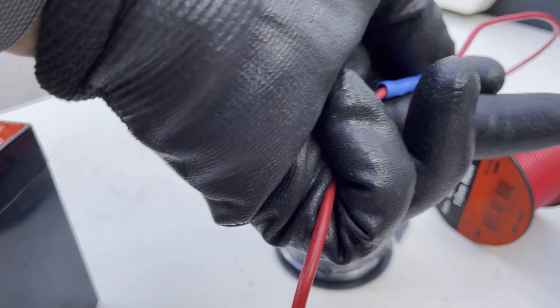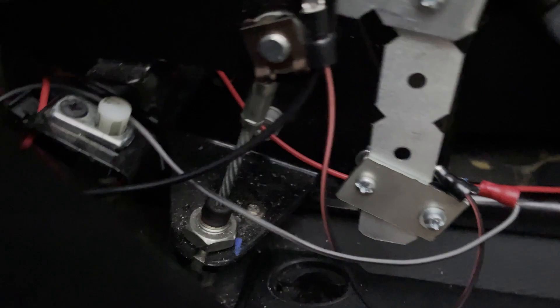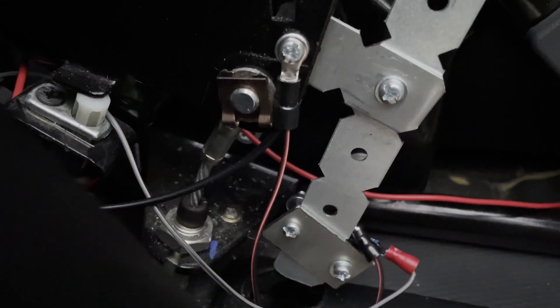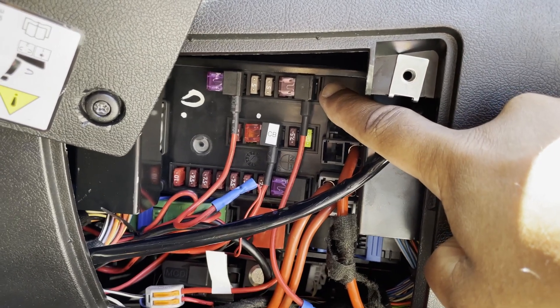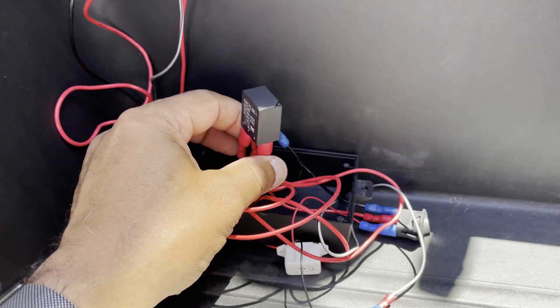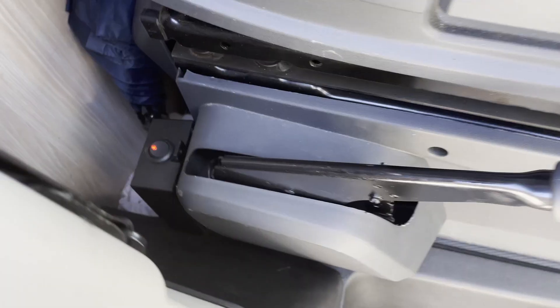This project is made out of three stages. Stage one is making the micro switch rig — this is the bit that tells whether the handbrake is engaged or not, telling you which position the brake is in. Stage two is obtaining power from the fuse box. And stage three is wiring it all together and putting it into a little box with a little switch.